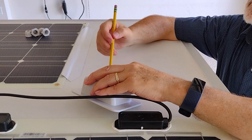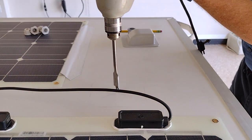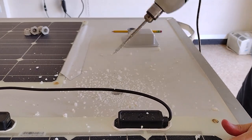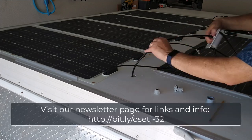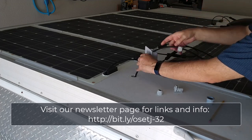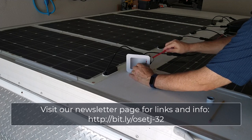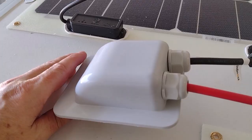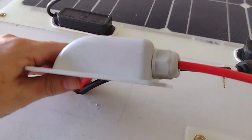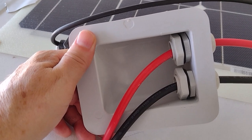Now that we have the wires connected we need to cut the hole they will go through. We mark the precise location for the double cable entry gland and mark the center as the spot to drill. Using our trusty quarter-inch drill we drilled a one-inch hole in the roof. We've drilled the hole and now need to run the wires through the gland and then through the hole into the RV. We slip the black negative cable through each component of the gland and into the hole, dropping the wire into the RV, then do the same for the red positive wire, taking care to get each piece of the gland in the proper order. Here's a close-up of the gland inside and out — it provides a stable connection for the wires and good insulation against the weather.